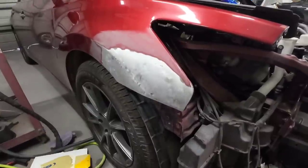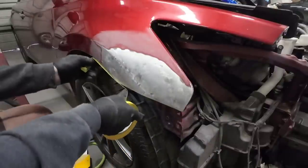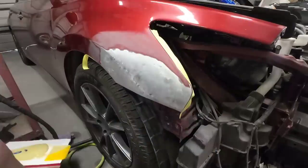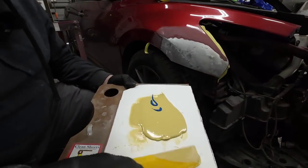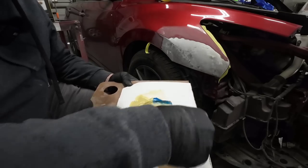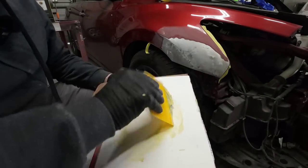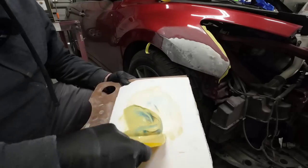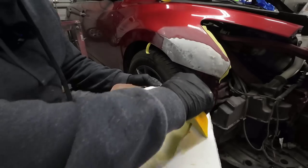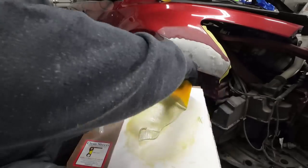The reason I want to be at the car when we mix this up is we want the maximum amount of work time with our filler. I'm going to tape up the edge of this — I don't want a lot of filler around the edge of the fender because then we just have to clean it up. When we mix up our filler you want to fold it in. Avoid stirring it because that's going to introduce air, creating air pockets and pinholes after you spread it out. If you spread it flat on the paddle you'll have more working time as well — it dissipates the heat and allows it to cure a little slower.